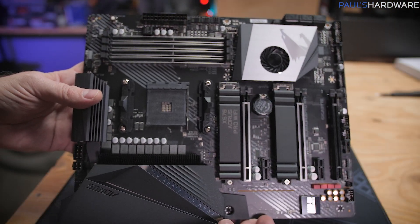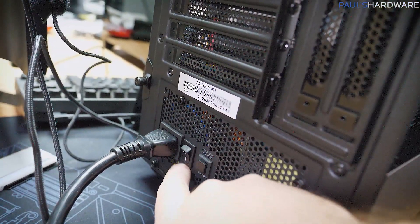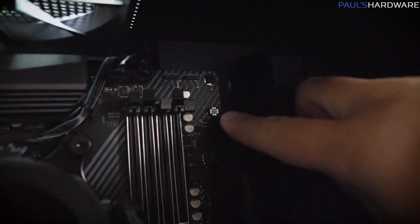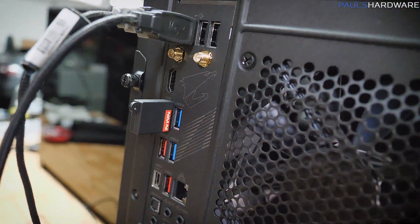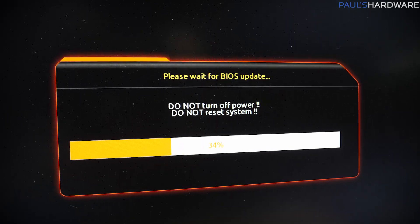Before I did any of that, I had to get the system up and running. I installed a 5000 series CPU in a 500 series AM4 motherboard and discovered the pre-installed BIOS was an older version that did not recognize the 5000 series CPUs. Fortunately the motherboard has a BIOS flashback feature — Gigabyte's is called Q Flash Plus — with a button physically on the motherboard itself. I downloaded the updated BIOS, dropped it onto a USB flash drive, renamed it Gigabyte.bin, and booted the system with that button. It blinked for a while, the system shut down, and upon restart I was greeted with a BIOS updating screen. After waiting a bit longer, the BIOS update worked.